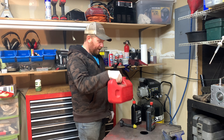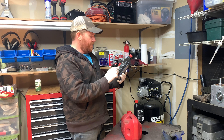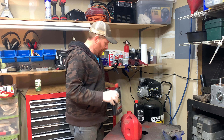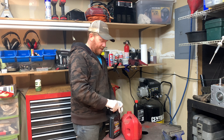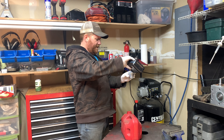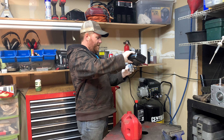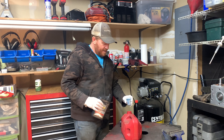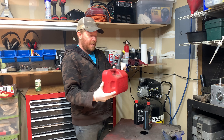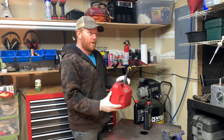I have a gas can that's exactly a gallon, so I just dump a gallon in there. It's 50 to 1, and on a two-stroke bottle it should tell you what the mix should be. For 50 to 1 with a gallon of gas, that's 3 ounces of mix. I've got a little shot glass with measurements on the side — I find this works pretty well since I do enough jobs with two-stroke engines. But if you want to make your life easier you can buy pre-mix. After you get it added in, put your lid on and agitate it a little bit to get the oil to mix in. Let me know in the comments if you mix your own or buy pre-mix.